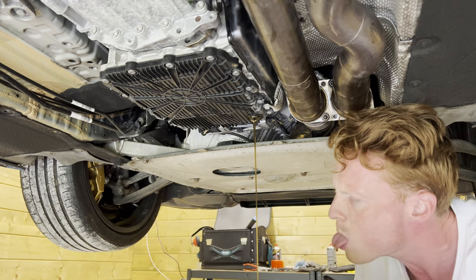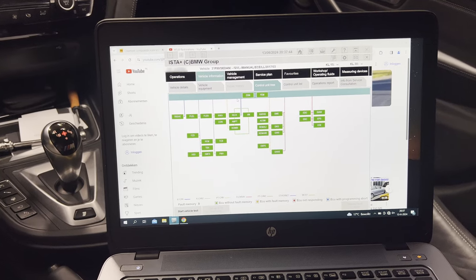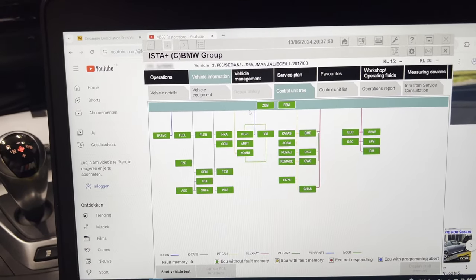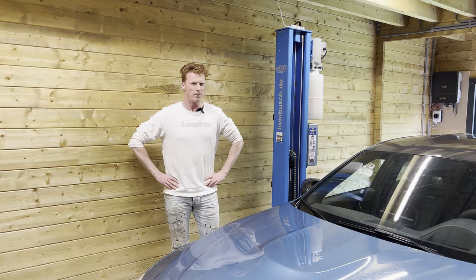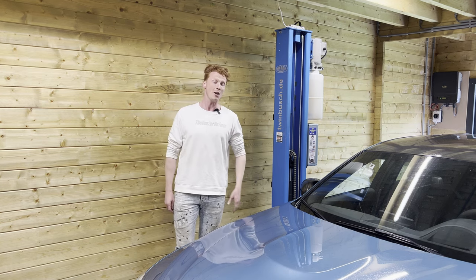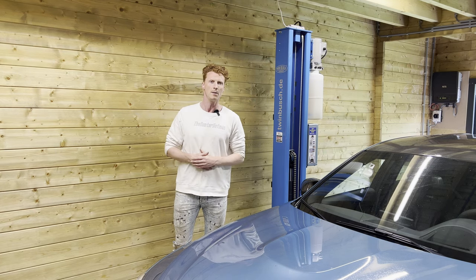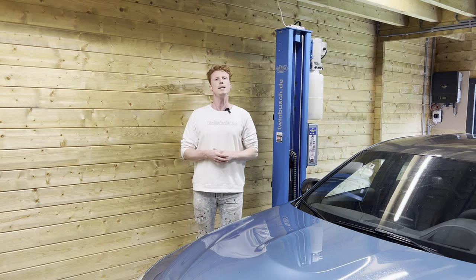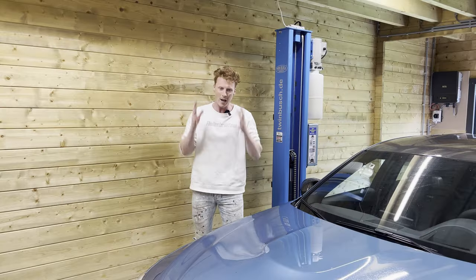Today I'm doing some fine tasting — quite bitter. I'm running late, and we get real geeky. Look at the completely green control unit tree, that's what we want to see. Anyway, today we're going to work on the DCT gearbox of the car. The DCT gearbox is filled with oil of which BMW states it's a lifetime supply — maybe the lifetime of a rabbit. So we're going to give the DCT gearbox a full service with all the correct and required parts. Afterwards, we're also going to replace the transmission mounts for upgraded ones.